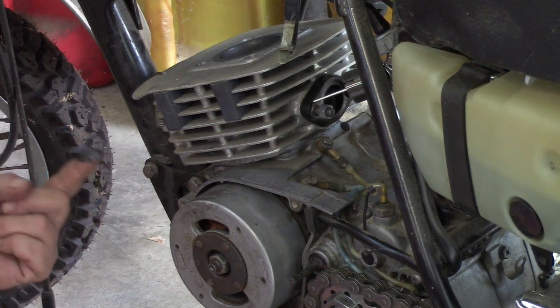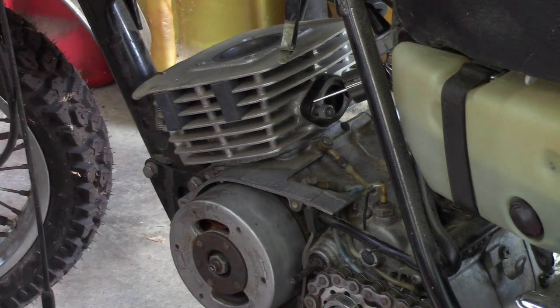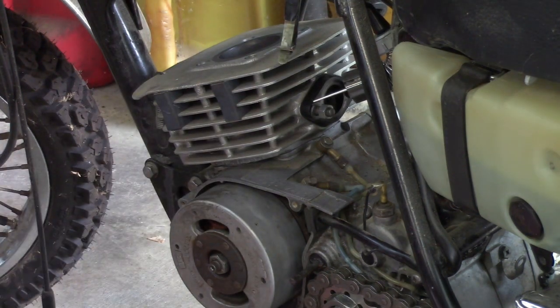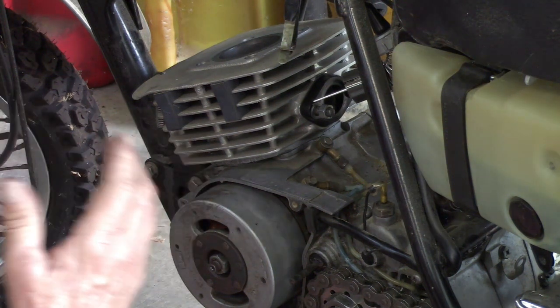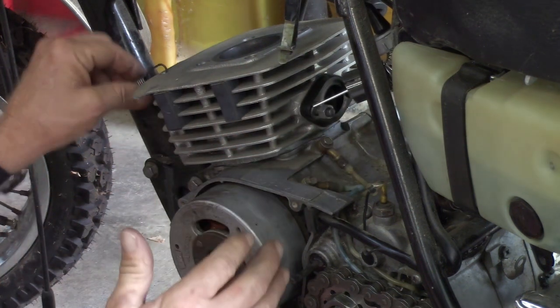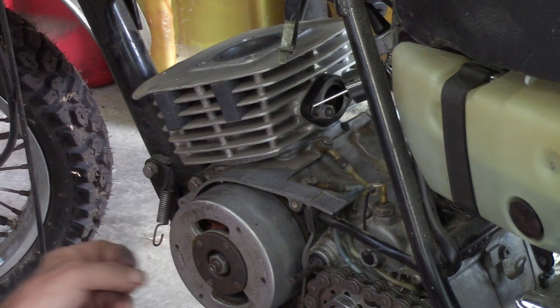There he is. Well, that's from that two-stroke oil from when I put it down the cylinder. Because if you're not aware, you can do that as a test. If you have low compression and you suspect it's your rings, you can shoot oil, like a teaspoon or so, down in there, and it'll coat your rings and it'll bump your compression up. So if that's the case, then you got bad rings. And I don't want to lose that.